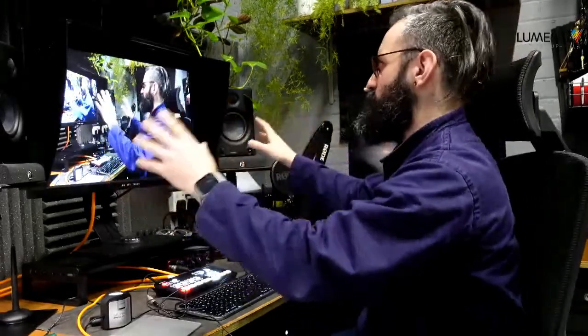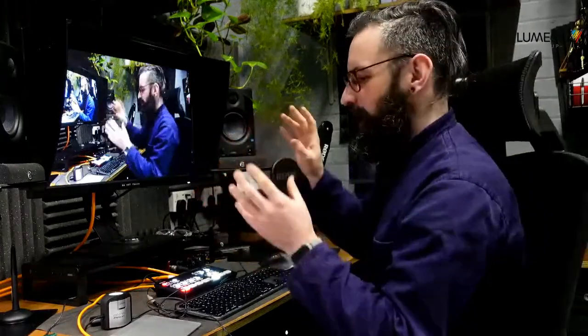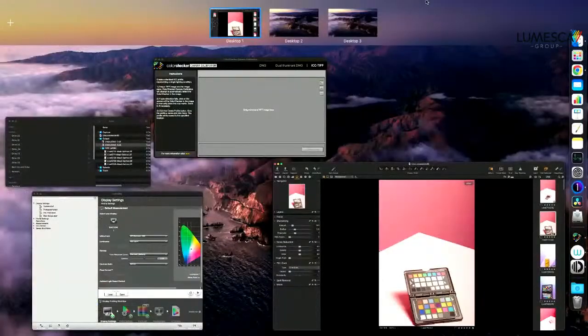In terms of calibrating: if I look at this monitor every day for the next six months it gradually shifts, and you won't notice you've gone out of calibration. Normally you'd calibrate every 100 hours, but I like to do a fresh calibration on every single job. We calculated that every 100 hours is probably about a week in the studio, so at least once a week we do a fresh calibration.